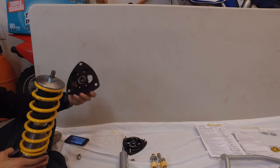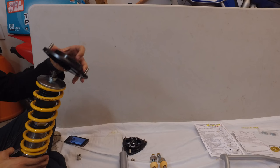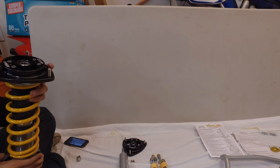Follow that up with a spacer. And then your camber plate, which goes on top of that. Now, which size spacer you're going to be using depends on which camber plates and brands you have, so keep that in mind to make sure you have proper spacing and room and threading on the top. And then next is the nut that you're going to be screwing onto the top.